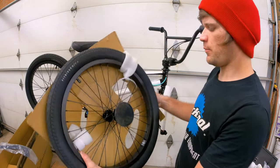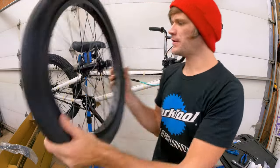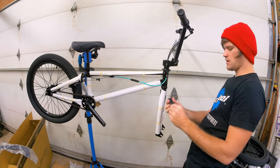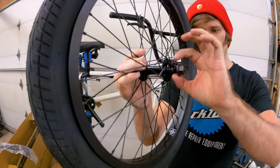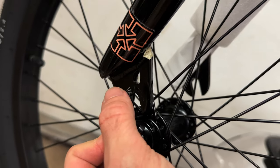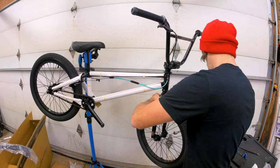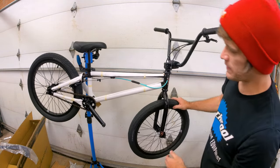Let's grab the front wheel and put it on. This has a 3/8 male axle, but it is actually a sealed front hub — pretty awesome to see on a complete bike under the $500 price range. It's a 2.4 tire and the PSI rating is 60 PSI. We take out the spacer that keeps the forks safe during shipping. The front wheel has a slot washer, so make sure the slot goes into the slot on the forks. Use a tool to ensure the wheel is bottomed out in the dropouts — fully seated — then tighten it down.